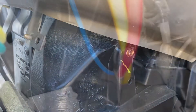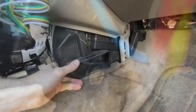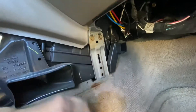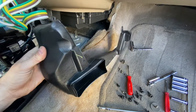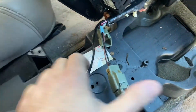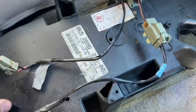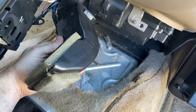This one is an 8mm. And that one in the back right there too. In order to get this piece out, you've got to take out these bolts - looks like a 10mm there - in order to pull this back and slip it out. That wasn't super easy to get out. I had to kind of twist and pull, and you can see I bent back the panel there a little bit, but it did come out. Just two screws right there, and then you had to unhook some different points on this wiring harness. Now this thing will pull free. This piece right here was just a pressure fit and I was able just to wiggle it off.